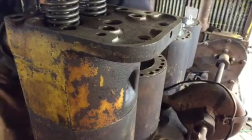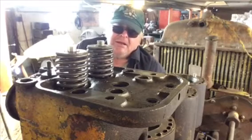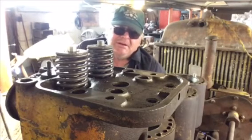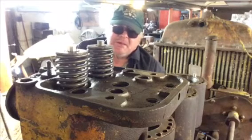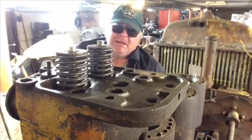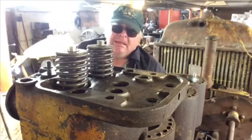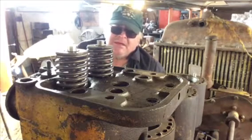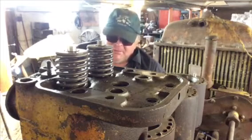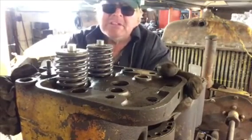Hold them set in place temporarily after I work on the pushrod tubes so they go in and out okay like they should. That's why I put the head gaskets on, so the spacing was right, and make leather seals to make sure they go in and out and assemble properly, and work on the exhaust manifold. I'll show you what I have to do with that and make sure the alignment is right. As you can see, the heads move a fair amount on those studs,